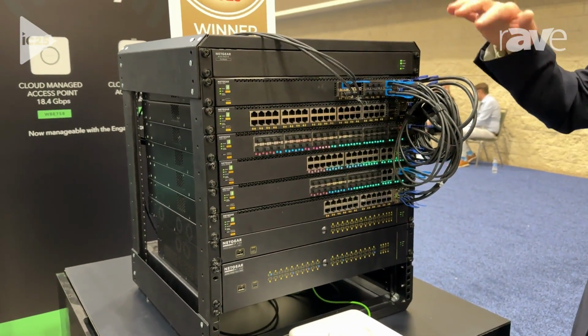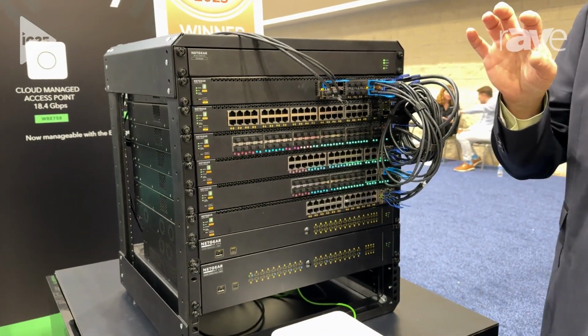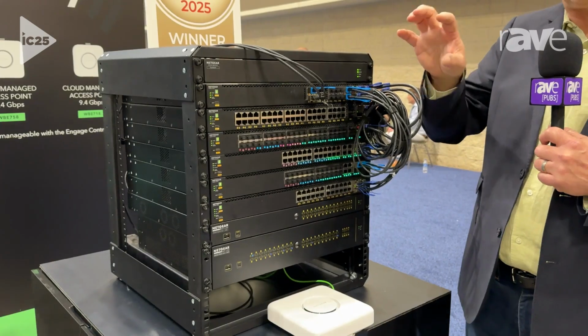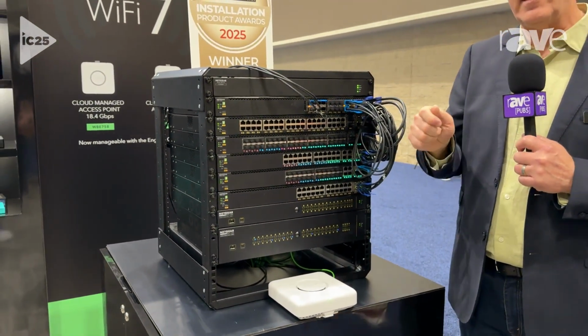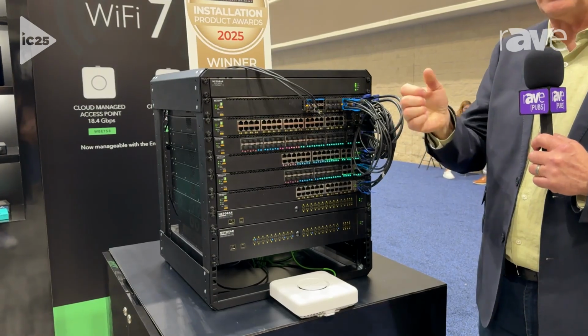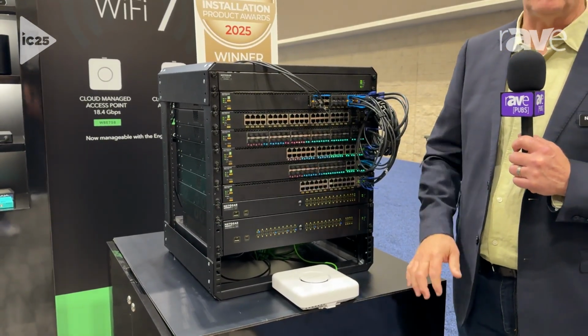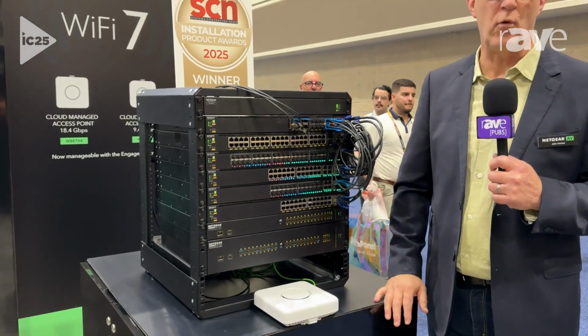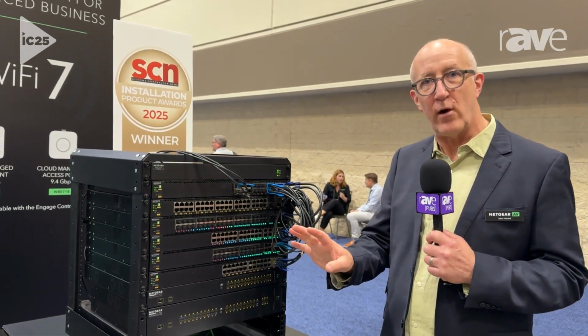Something else that I can't show you here in the rack, but we've also helped the power connector on the back. From the power switch, we have a little cover that fits over that connector, and also for the power cable itself, to help retain it as it's plugged in, like a zip tie sort of thing in the back. Those are helping to maintain power through accidental turn off or accidental power cable removal, whatever you want to call that. That's new on these M4350 switches.